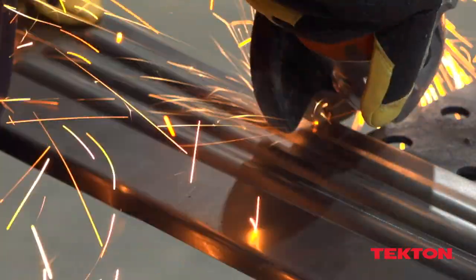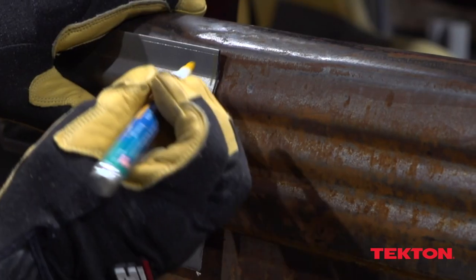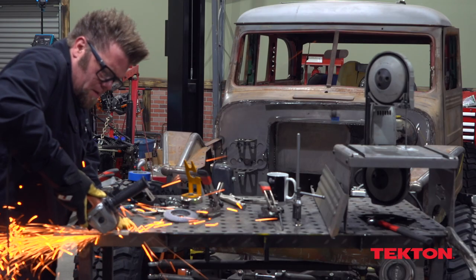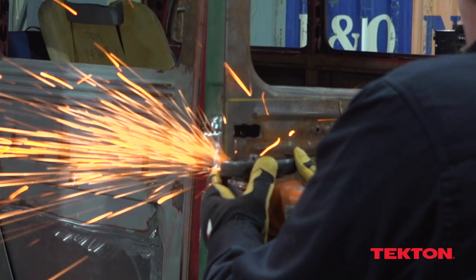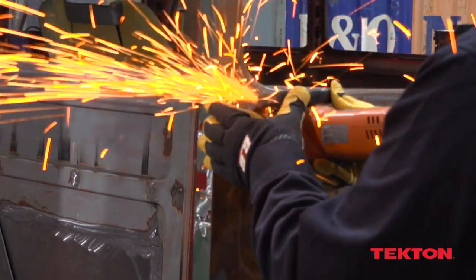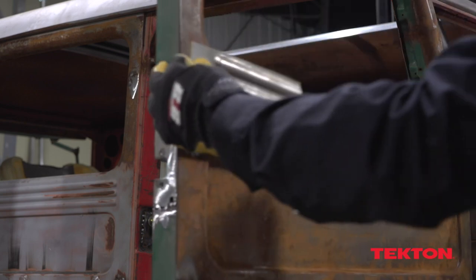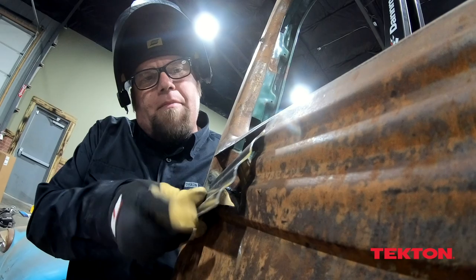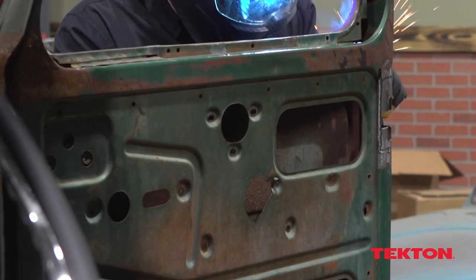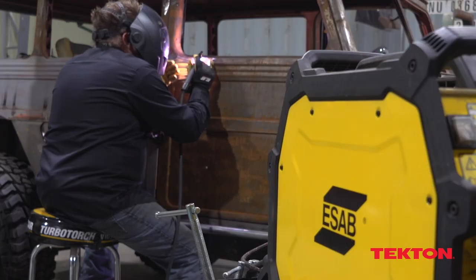I picked up a complete door lower patch panel for a Willys wagon - it has the same body lines at the top of the door. I'll scribe it, cut it out, transfer the size onto the door, mark it, cut it, and grind until it fits perfectly. I want a butt joint with no overlapping at all. Once it's fitting well I'll tack the entire thing with the MIG welder, grind it off to check it, then go back and fusion weld all the edges with the TIG. Then I'll grind it down, metal finish it, and it'll need a very small amount of filler - it's gonna look damn cool.